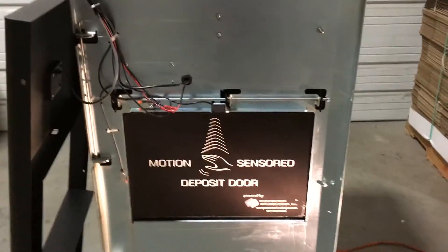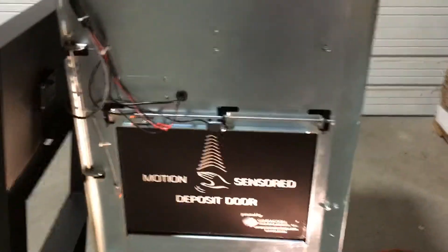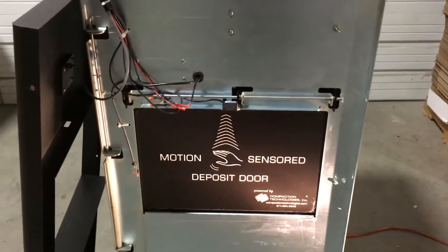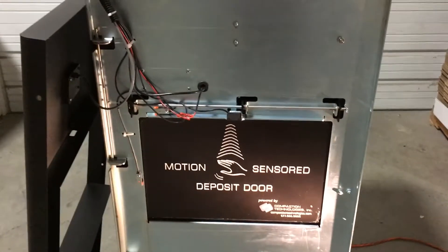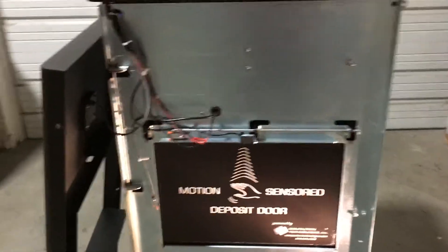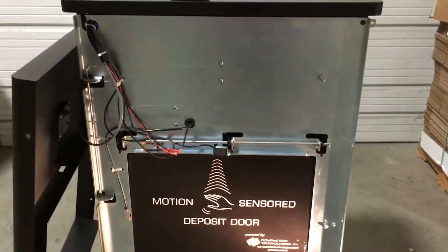To test if it's in the right spot, wave your hand at the motion sensor, wait until it opens, and push until you hit the trash compactor head cover. If it's only about half an inch, that's the right height. Anything more than that and you'll need to raise the L-bracket up. If it's anything shorter than that and butting right up against it, lower the L-bracket just a little bit. The sweet spot is about half an inch of play until you hit the compactor head cover.